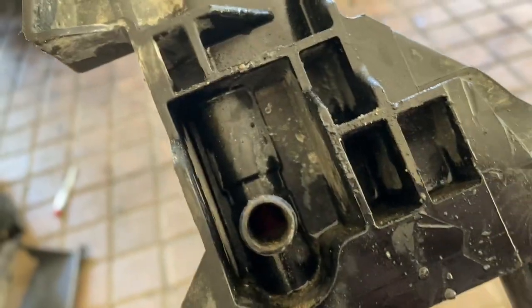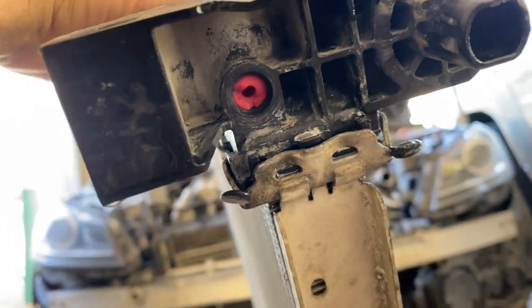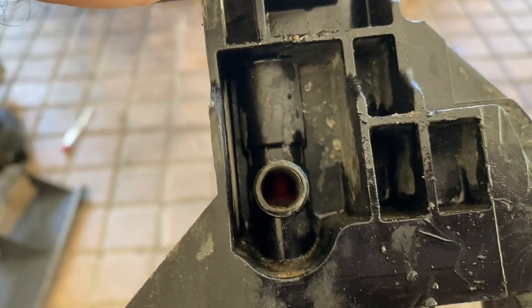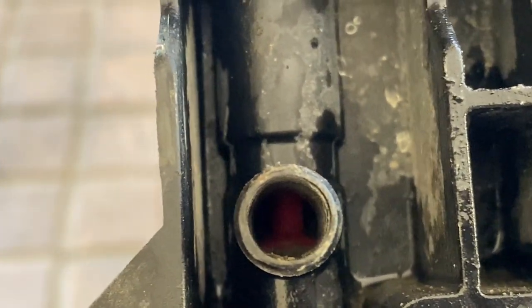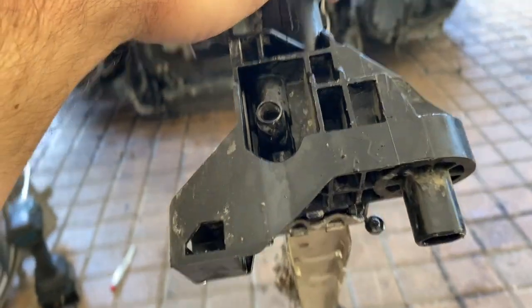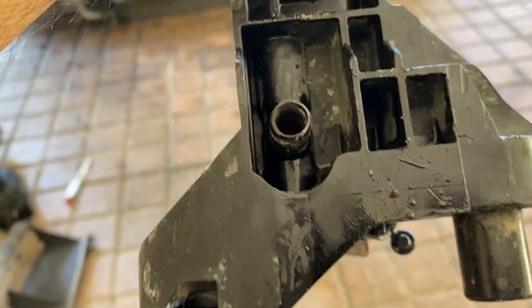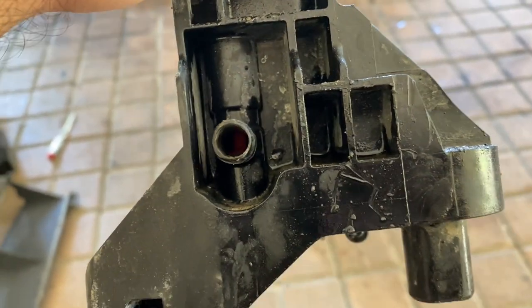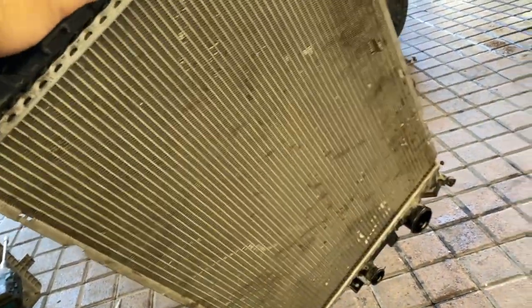What I've come to realize is that the leak might actually be from this drain hole. What I thought was that the bung gets screwed out completely and the water comes out the bottom, but I believe you turn it out halfway and then the rest of it — you can see the red bung — comes out this hole. There is basically an upper and a lower o-ring, so maybe the upper o-ring is leaking, which is in turn making coolant come out from that hole. Now we'll get it pressure tested and see exactly where it is leaking from, since I thought it was along these seams because they tend to corrode after a while and leak.